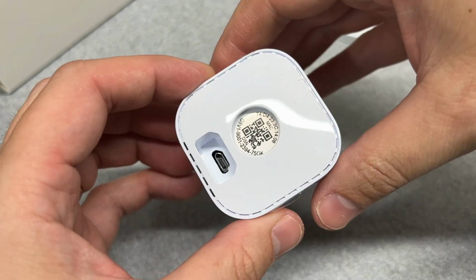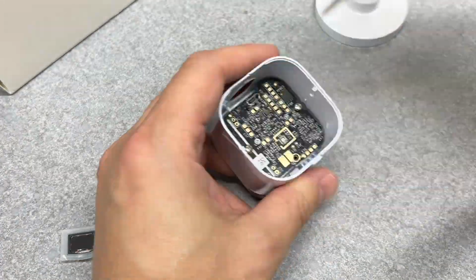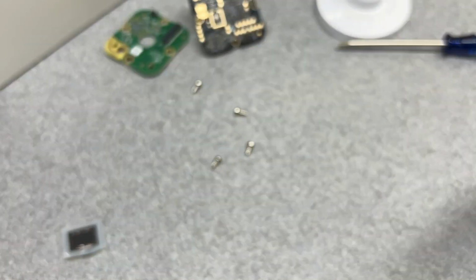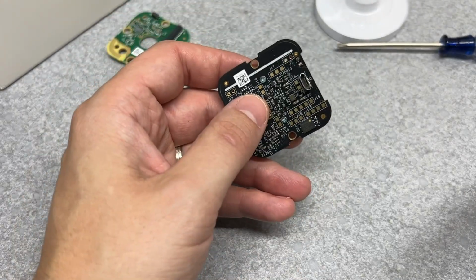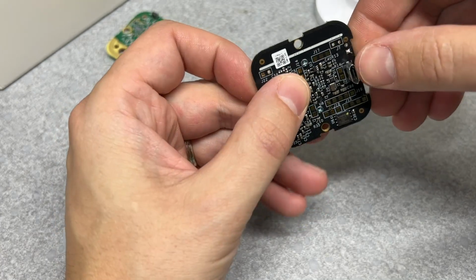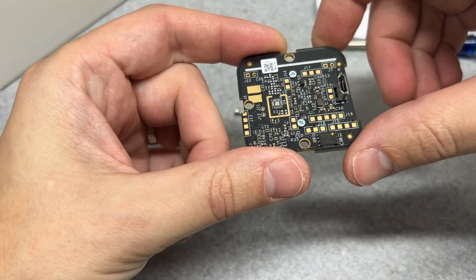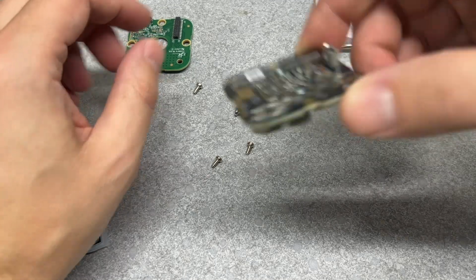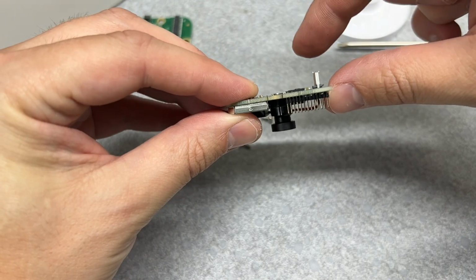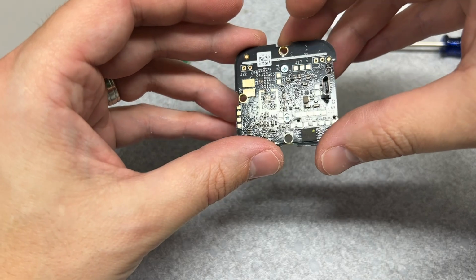You take the camera apart and strip it down. So once you've got the camera stripped down, this, I don't know what you call it, where you plug in the power here on the camera, this is problematic because when you mount the camera with the lens facing down, it obviously sticks up that high. And when it's sticking up that high, it's going to hit the gantry, or the gantry will hit the camera.